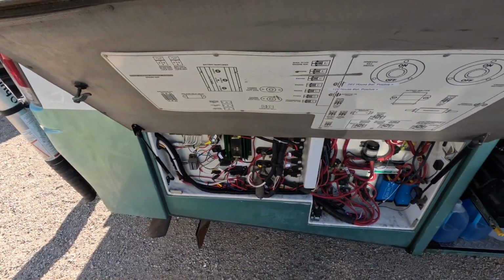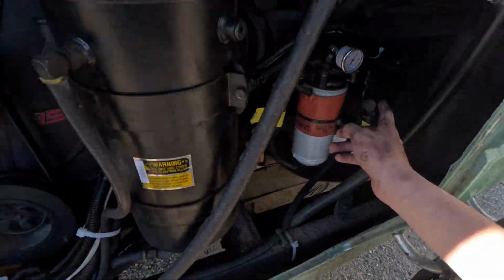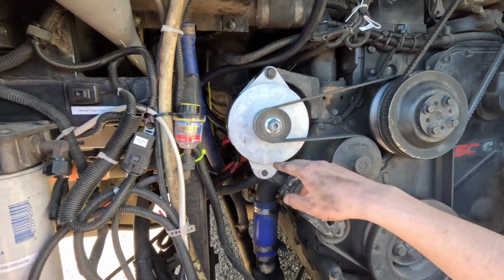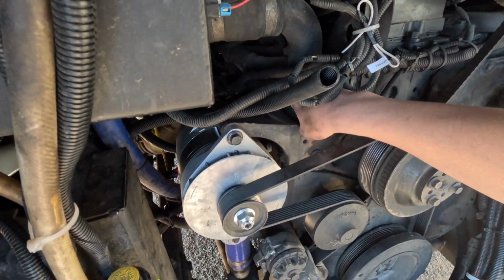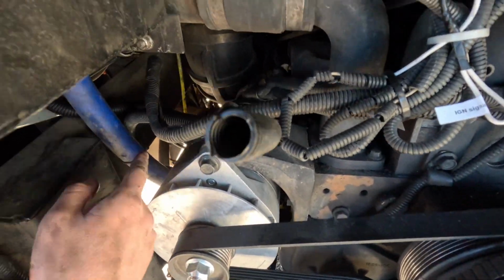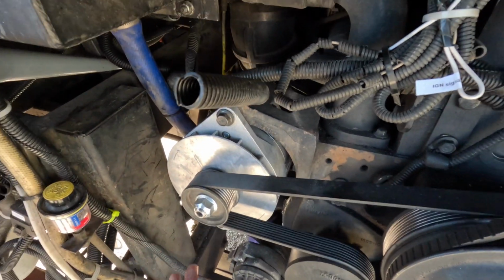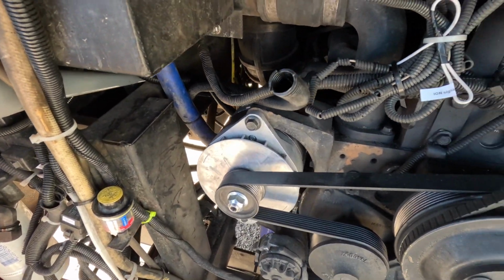Okay, everything's alright. And the wire goes from here through the back. There's a hole there to here, and then all the way here and around and to the alternator. And the negative terminal, the original one that's connected to here, see a little bolt here, that's the coolant hose. But anyway, it's grounded here, that's fine. I'm adding another ground from the same terminal in the back to here. That's my coolant surge tank mount. And I scratched it in the back to make a better contact. And I'm going to spray some battery terminal protection later.